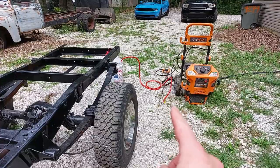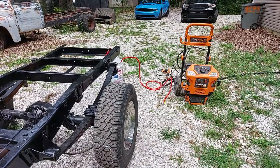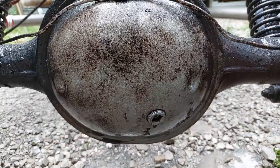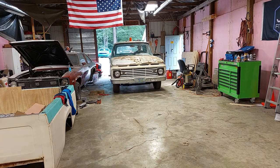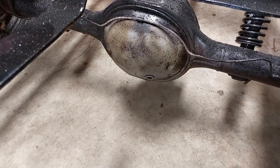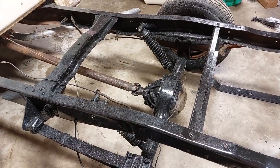So I'm going to explain how this setup works. Basically you get your pressure washer and there's a quick-connect wand that goes on the end, and then a little tube that you run into just a five-gallon bucket or a bag. It's got a little tube that picks up the sand and blasts it with the water. It's a really good setup because it cuts down on all the dust from regular sandblasting. That did an absolutely amazing job of getting all that built-up stuff off — God only knows how long it's been caked on there. So we're going to put POR-15 on it, like we did the rest of the frame, clean everything up and then move on to the brakes.